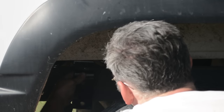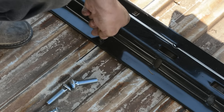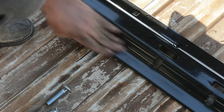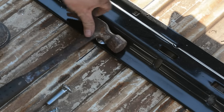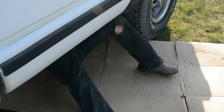Put a frame plate under the rear hole on the other side the same way as the first one. The front two holes tighten down just to the bed, just like the very first hole. Now you are done with the back rail and can start on the front rail. Using that center line, we mark and drill the front center hole. Then under the truck again to tighten that one down.